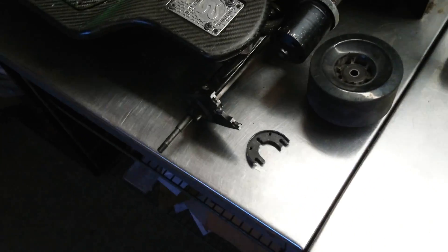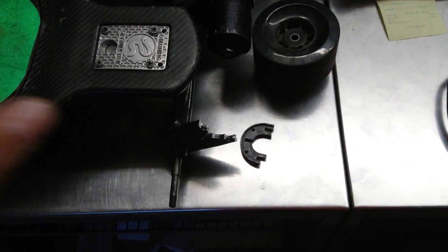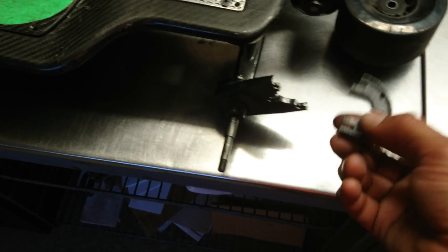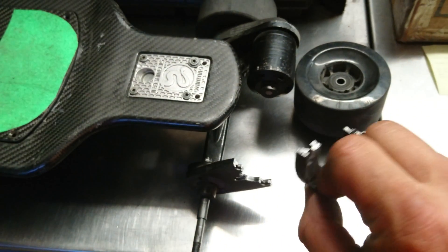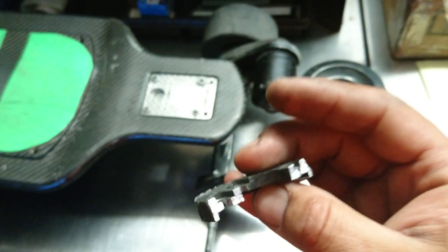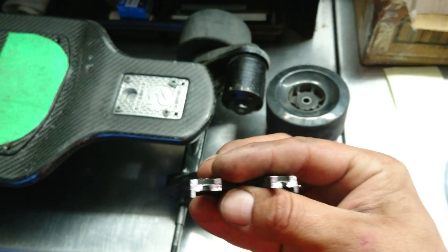Today I ate a belt and it looked like my pulley wasn't lined up. When I stopped and inspected it, sure enough this was cracked in half. This is what happens due to road vibration — you get all sorts of breakage because this is pot metal, just like the base plate I had replaced. Cheap pot metal cannot withstand road vibration.